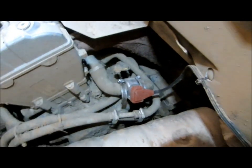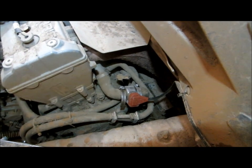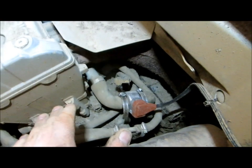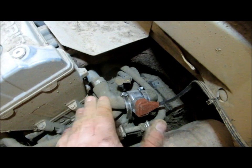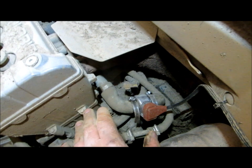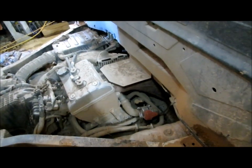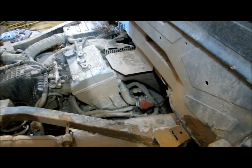As for the heater being too hot or something like that, they are thermostatically regulated, so when they get up to 170 degrees it'll automatically kick out, so it will not burn up this engine. It is a little bit too big, but it's the smallest heater I could even find, and I've been running these on our 570s for years with no problems, and they're an even smaller engine than this. I mean, they're almost half the size, so no issue there. Thermostatically controlled, so not a problem. Like I said, they're just 400 watts, so shouldn't even use a lot of juice.